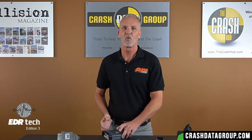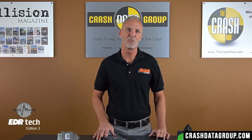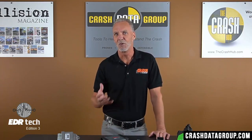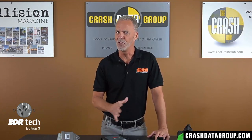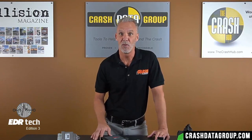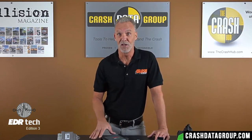Another commonly asked question is: what is FlexRay? FlexRay is a high-speed communication protocol that differs from the CAN communication protocol used by many auto manufacturers. A communication protocol is basically a computer language that allows different systems in a vehicle to communicate with each other. FlexRay was developed to offer a much faster and more reliable form of communication for more advanced, technologically advanced systems being added to some higher-end vehicles.